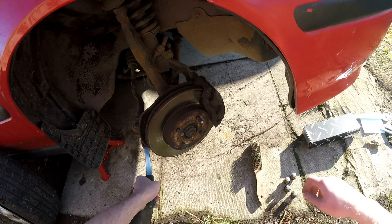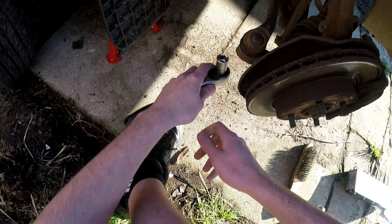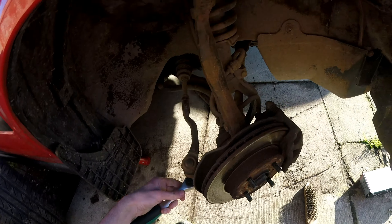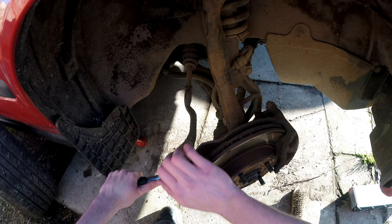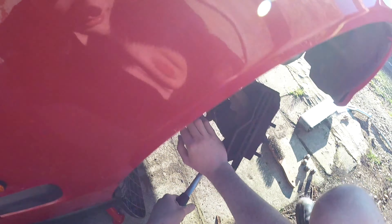It does have a split pin there, so we'll try and break that off at some point. But I think our first port of call should be to wire brush this so we can see what we're really dealing with. The socket is over it now. Basic principles of things — righty-tighty, lefty-loosey. We'll get it on at a bit of a different angle. That's going right so that's going tight, so we can switch that at the back of the socket. Then we'll begin attempting to crack this thing off. Because it's rotten, I don't expect instant movement with this — it's going to take some force and potentially a time-lapse, and me making some funny noises. I hope I don't break the damn ratchet either.